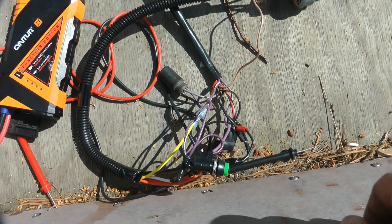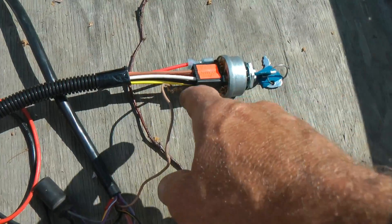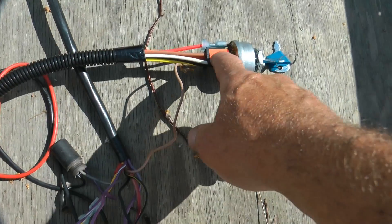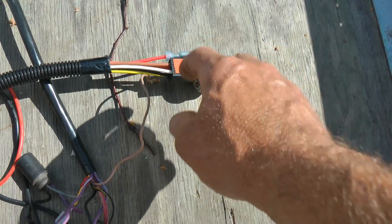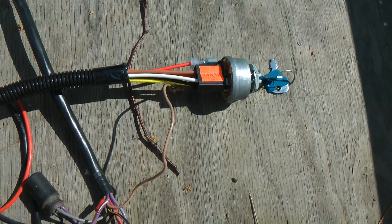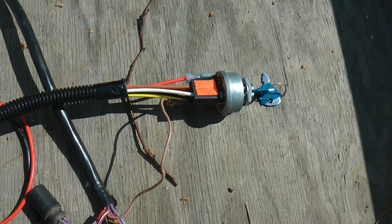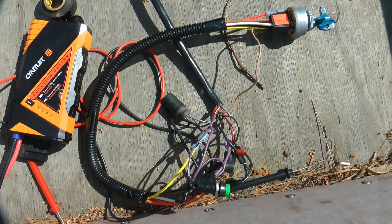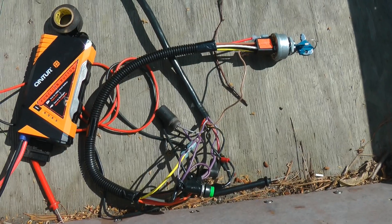This is sort of proof of concept right now. So after about an hour of carefully doing all this, I think I finally got it together. I had just pulled this off and found that stamped on the back of each terminal is a clue as to what each one does — B for battery, S for starter, L for loads. Probably should have checked that first. But I think I'm at a point where I'm ready to try it and see if I can get it to do what it's supposed to do.